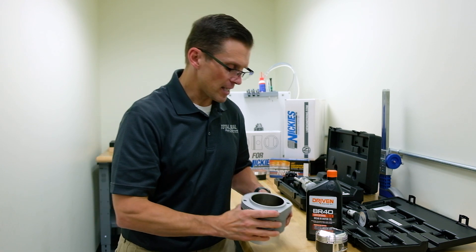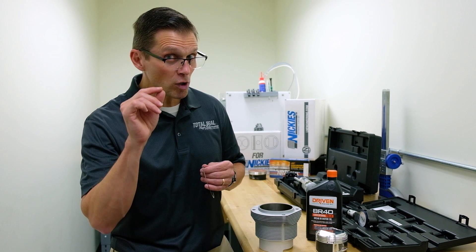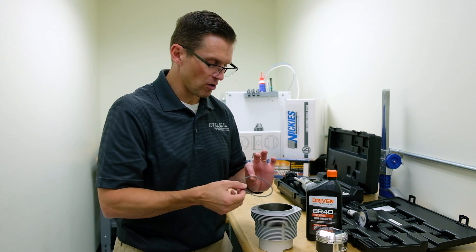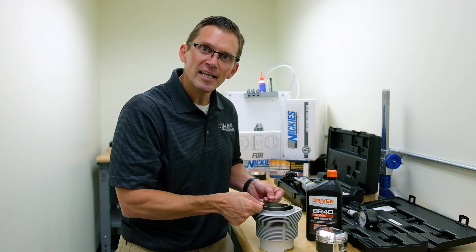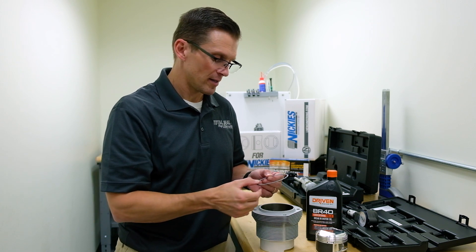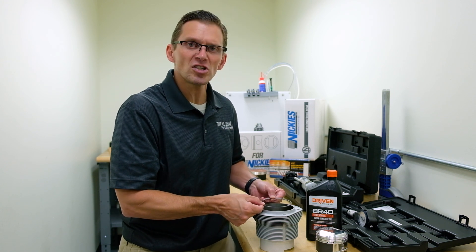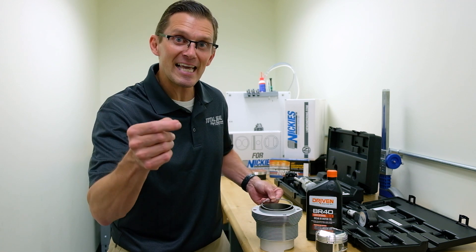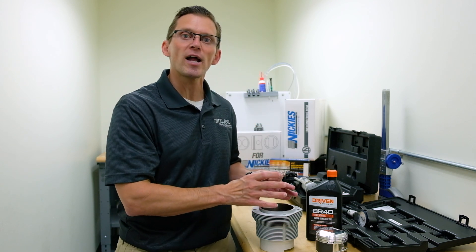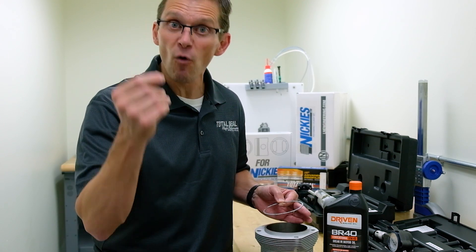The key thing is to get that piston ring to seal properly against the cylinder wall, and you'll recall this from the video where we discussed gas ports. You have to have cylinder pressure forcing the ring out against the cylinder wall. If you idle the engine and don't drive it hard, it never gets the gas pressure — it never has the load required to push against the wall to create the friction that generates the heat that activates the ZDP that helps form that gasket that helps seal everything together.